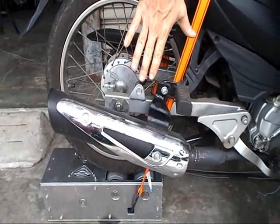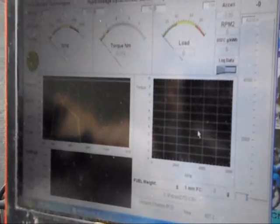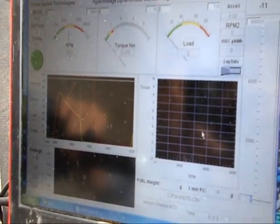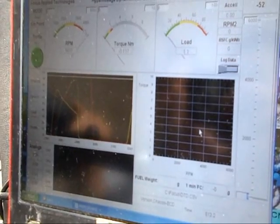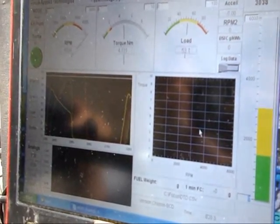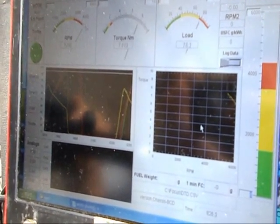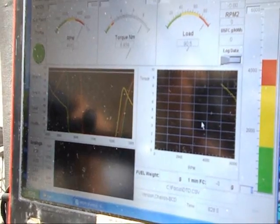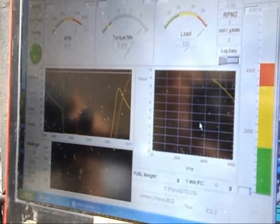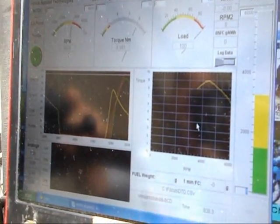This shows the appropriate mounting of a conventional 100cc four-stroke motorcycle. The dynamometer controller has been connected to the dynamometer, and we'll be looking at the dynamometer screen for analyzing data. I'm going to open the throttle, increasing the speed, then increase the load to slow it down — and thus we can trace out the engine's torque curve.